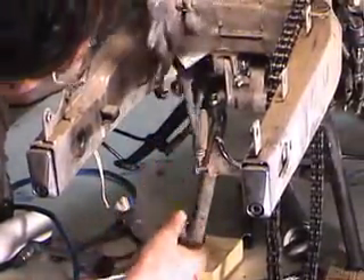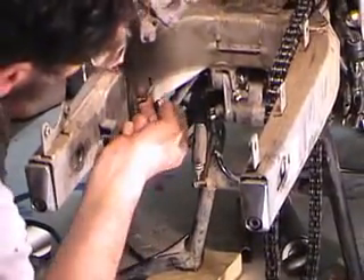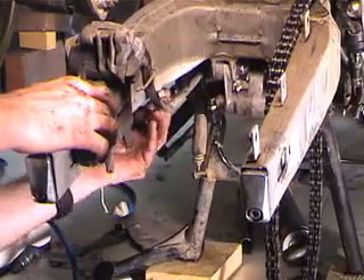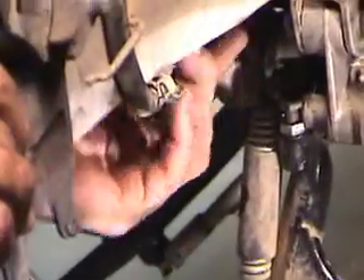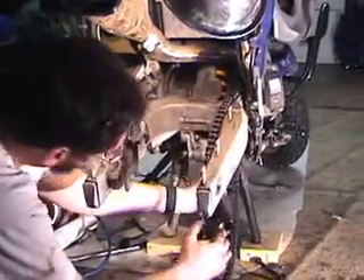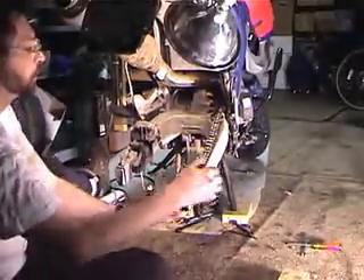I'm going to put the brake back on. In order to do that, remember we have two clips and this little metal thing — pop the metal thing up. The brake's just going to sit right there, and then the hose goes in those little clips and they just snap. There are two of those. Now notice the chain is under this roller and it's above the bottom roller, so we're in good shape to reinstall the rear wheel, and we've already covered that.